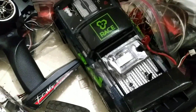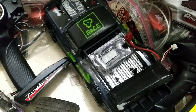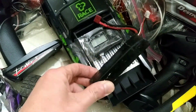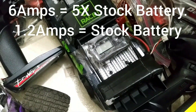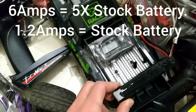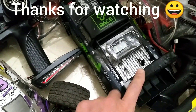Alright guys, we're back. I'm really sorry to waste your time because it did not go past 17 miles an hour. But the good news is by adding a second 3 amp battery — total of 6 amps — we got 16.77 miles an hour, so you only lose one mile an hour and you have six amps instead of the stock 1.2 lithium iron. This one's LiPo.